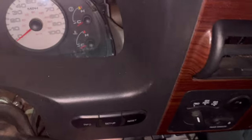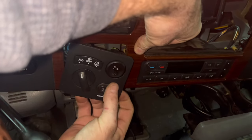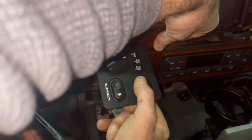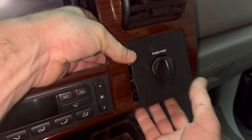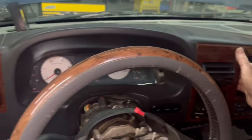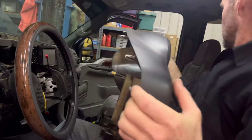In order to do this it's a lot easier if you have the shifter down. If they're nice and loose, you can do this, you can do that, and then cock it to the side — get it out right there. You don't even have to disrupt it. Same with this, cock it up a little bit — there's little lock tabs, be careful, you'll break the crap out of them. Down here you've got the plugs for the climate control; best if you have a hand on the top and a hand on the bottom and push them out.